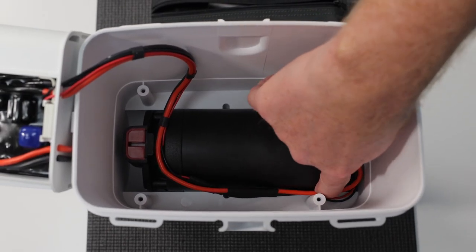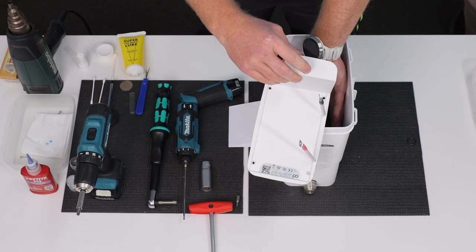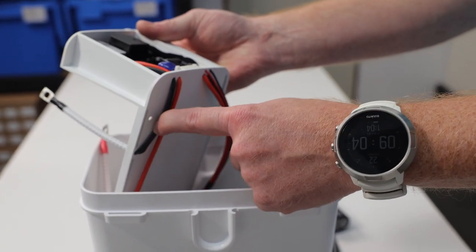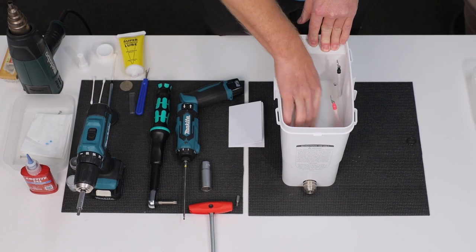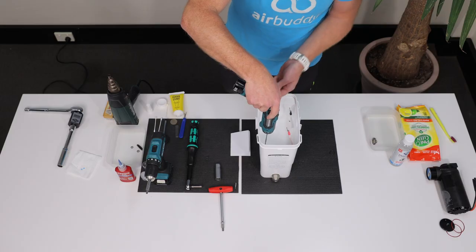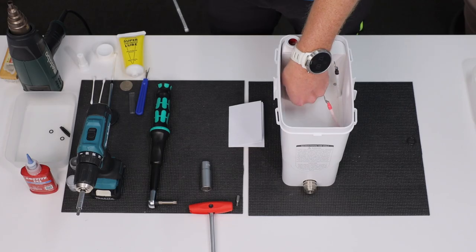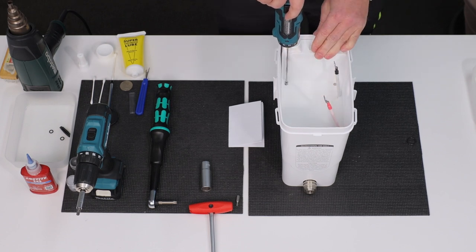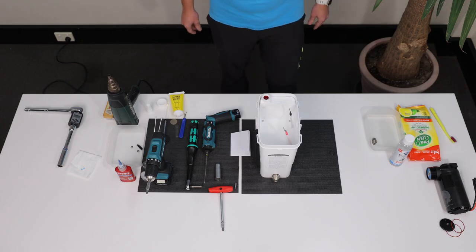When closing the platform, make sure that you route the wires along the compressor and under the tooth on the compressor breather. Gently push on the black wire sideways to make sure that it doesn't get pinched between the platform and the screw boss on the housing. Now, close the platform and press firmly by hand to ensure that each corner of the platform sits on top of the screw boss, and none of the wires has been pinched. Fasten the screws by hand screwdriver, or if you use an electric tool, set it to the lowest torque setting and then moderately tighten by hand to prevent stripping the thread.